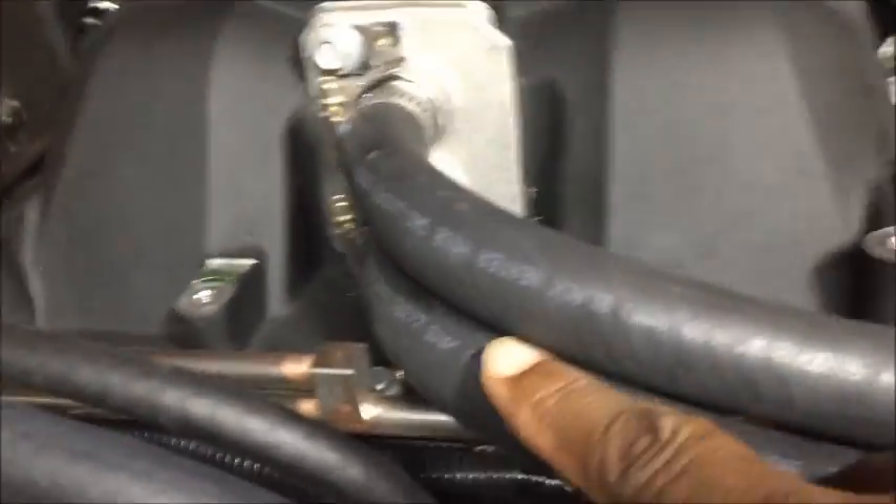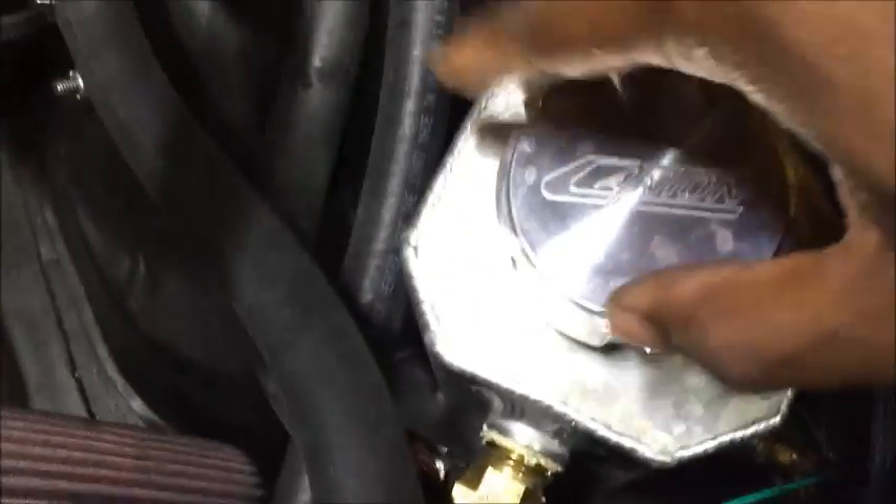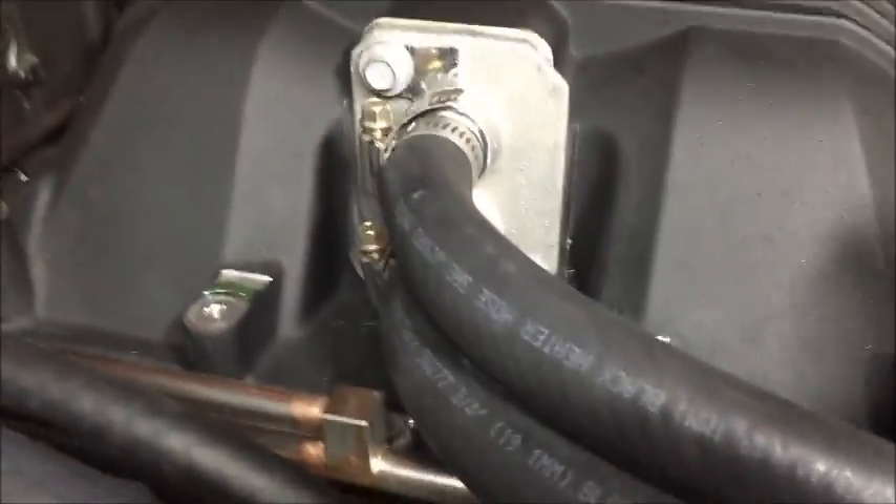This is how I ran mine. The water's coming out of the brick, going all the way down into the reservoir. It comes out the reservoir and loops into the pump. Out the pump, through the firewall, to the top of the exchanger. It's getting cooled all up in here. And then it comes out of the exchanger, through the firewall, back — bringing that nice, cool water to the top.